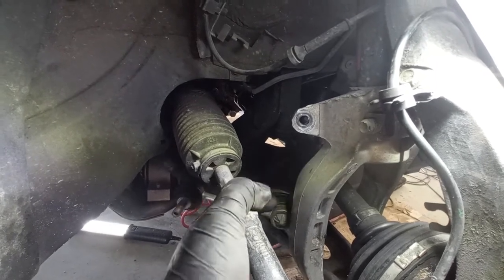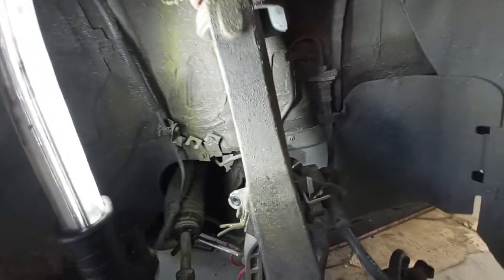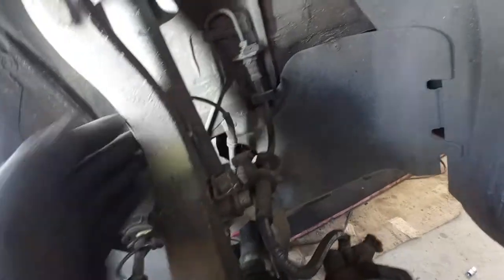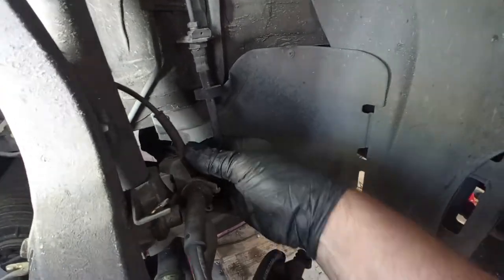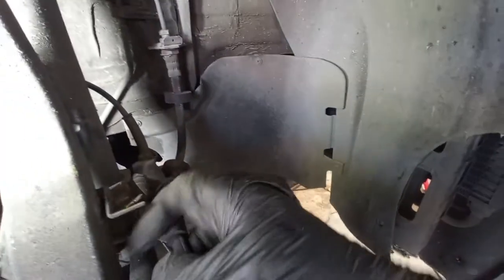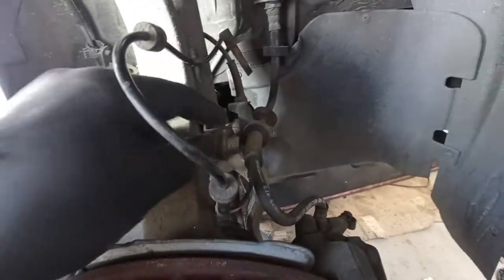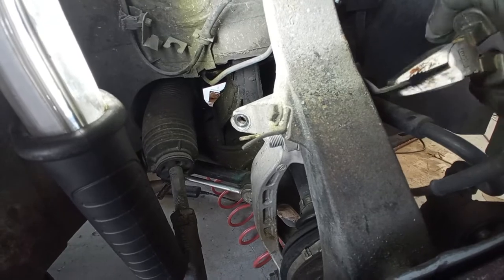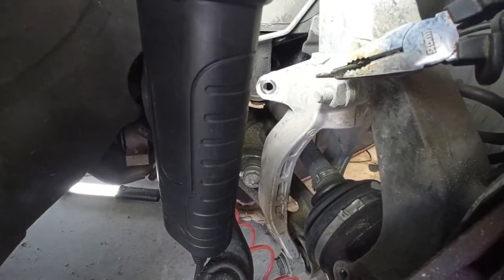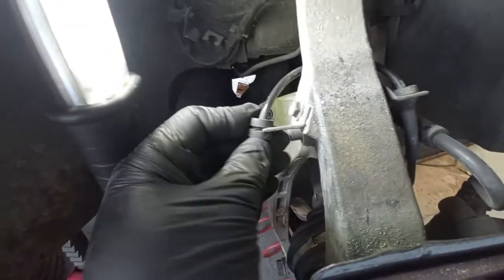This sway bar is shot. Okay, as they move about like this, they are not good for Alfa 147, GT and 156. Now here pointing down. Now pull it to the side. Now raise this up. These two tabs over here are not great. Let me just give it a little bit of a kink, just with a pair of pliers. Cool. This one up. Now like this. Now through there. Okay, from behind. Now in the hole. And put the screw back in.